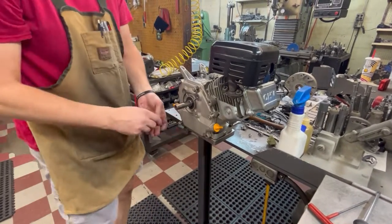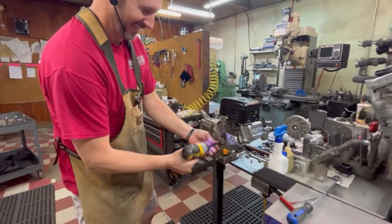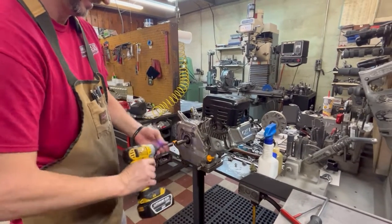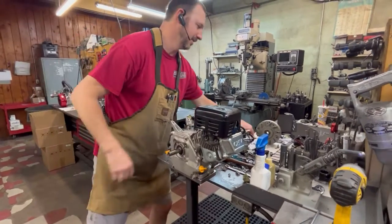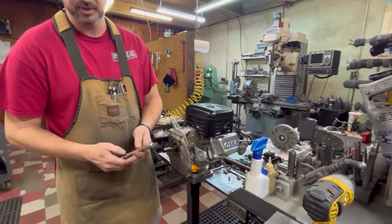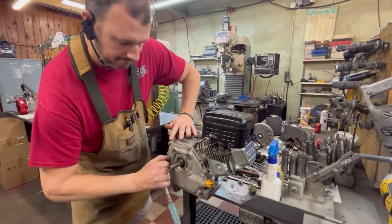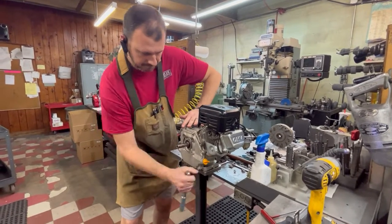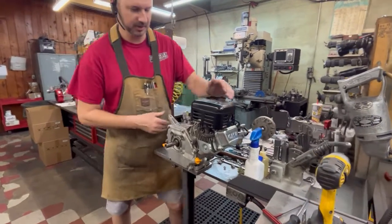In case you hadn't figured it out by now, we're in a live working shop today - that's all the background noise and people talking. Start off the six bolts. I'm going to recommend you torque them to 220 inch-pounds. I've already preset our wrench. Outside cover's reinstalled.